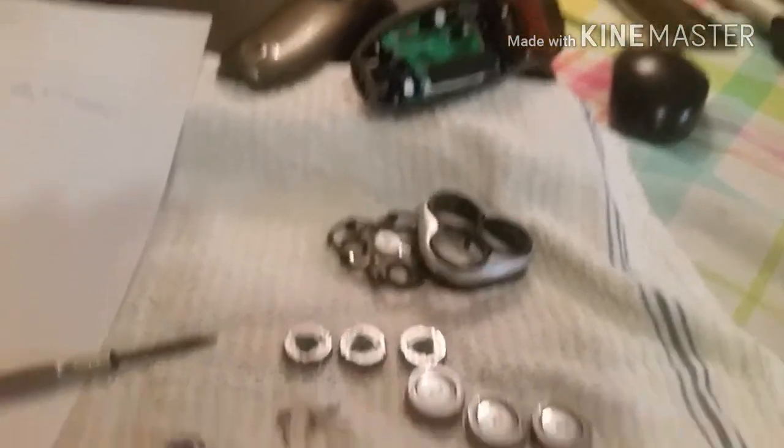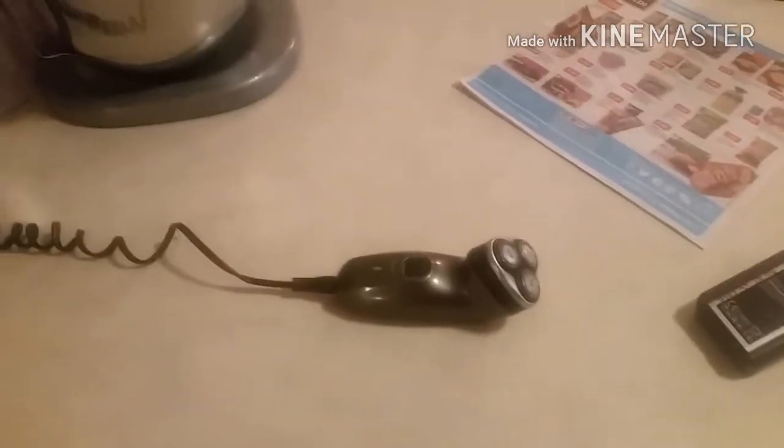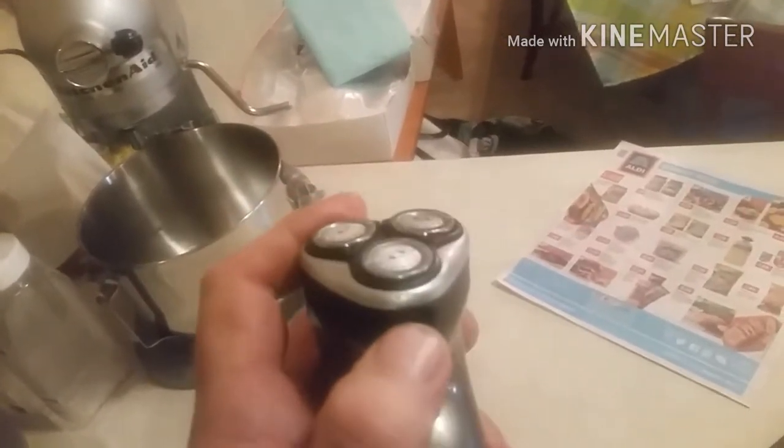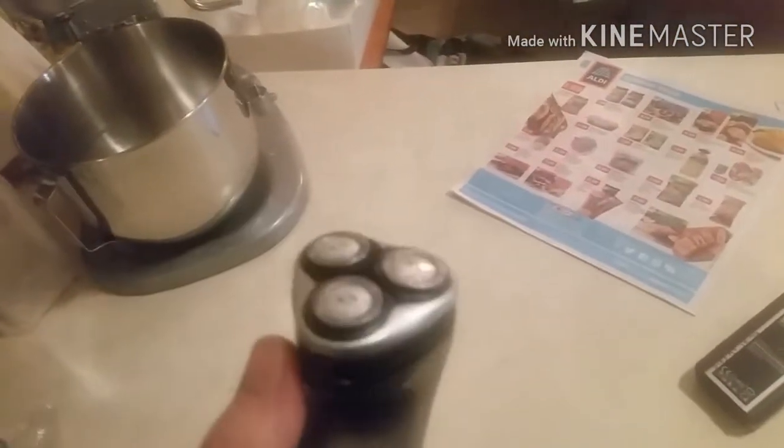But not least, I've taken one apart. I've shown you how everything works inside, and you can be the judge of whether it's worth fixing yourself. Let's finish this up — the secret here, the real behind-the-scenes truth of what you're going to do to make this project work and be happy with the results of your new blades. You can see this is running, plugged in, left here in the on position, and it's been running for about 15 or 20 minutes. Remember when I told you we tried it before — I was getting a substantial drain on the motor and lowered RPMs every time I would hook the blades into the on position. I tried all the different possible combinations of new and old cutter heads and new and old blades, and I just couldn't get anything to work where it didn't draw down on the motor and slow the RPMs way down.